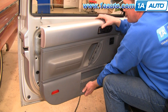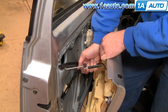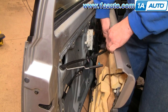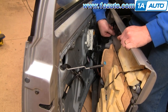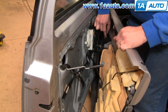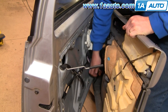Pull out on the door panel and then once you have it free, pull it up. Now in behind, depending on what options you have, just disconnect everything. There's a connector here — squeeze a couple tabs. Sometimes your cable for your door handle pulls out and then unhooks. All these connections just have a little tab that presses and you can pull them out. Then down here, pull these connectors off.